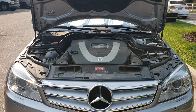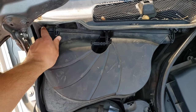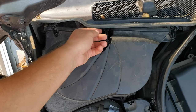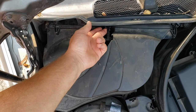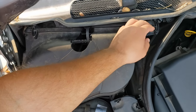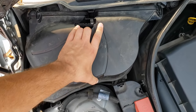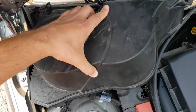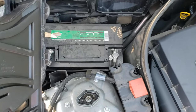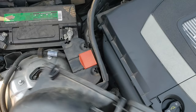On the leftmost side near the firewall you'll find a black box with three latches that should easily come undone just using your fingers. This cover is also part of the cabin air system, which is why it's so bulky. Once you remove the cover you'll see the battery.